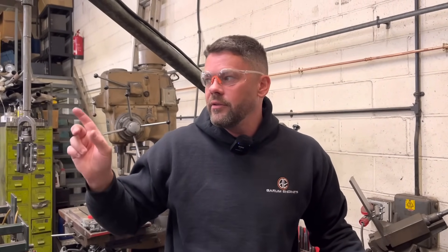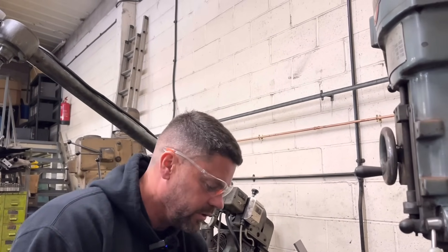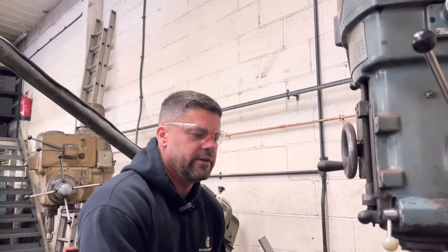We've got another Cosworth turned up — full Monty, out of a four-wheel-drive Sapphire, one owner car. Done 120,000 miles on its original engine, which is respectable. The car's all good he said, didn't need restoring, just tarting up a bit, but he wants the engine freshened up. You can tell it hasn't been messed about with because it's still got the cover on it. Looks like someone's attempted to re-con the rocker cover at some point and hasn't faced over the top — doesn't look too great.